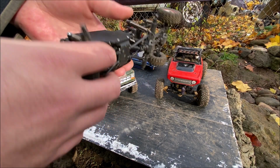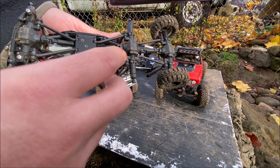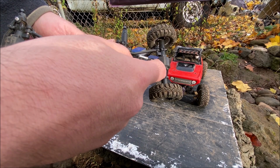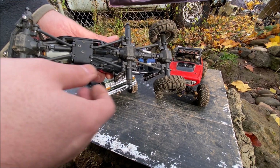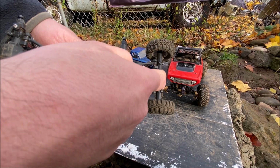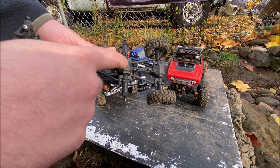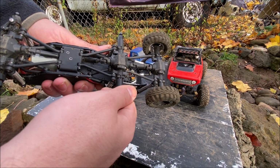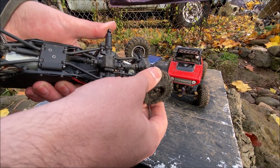And then here, if you want to do this, it takes two axles, and basically you piece them together to put the inside where the drive shaft would go on both sides. Once you do that, you have a pass through, and you can see how it works. You have to flip the diff in here, so you get rid of them two little pegs in there that keep you from doing that, and you have to do that on one side here too. But once you get all that worked out and the drive lines cut, it works perfect. You can see I've got plenty of flex, plenty of movement.